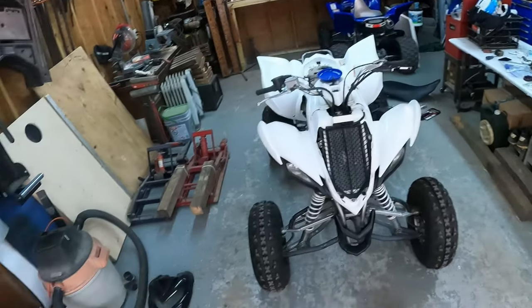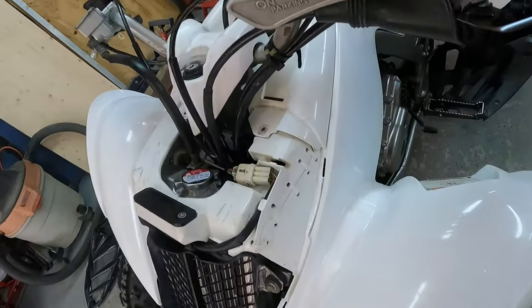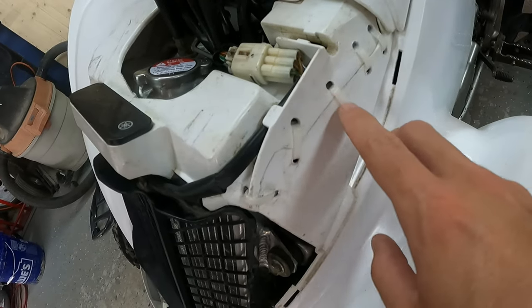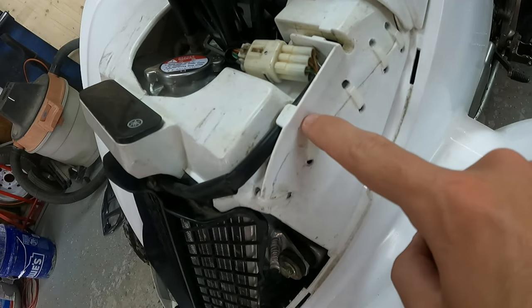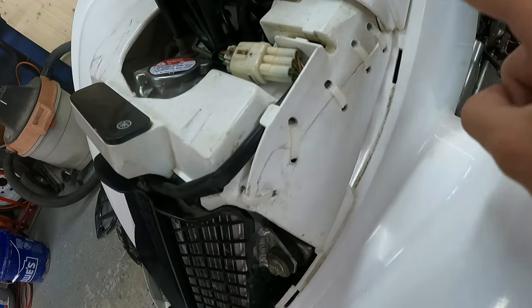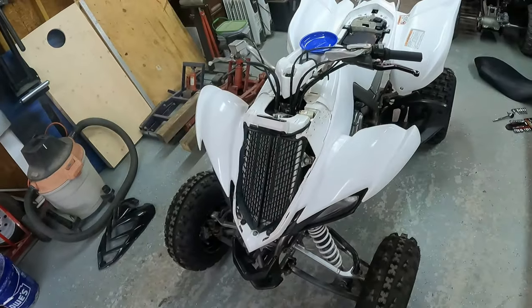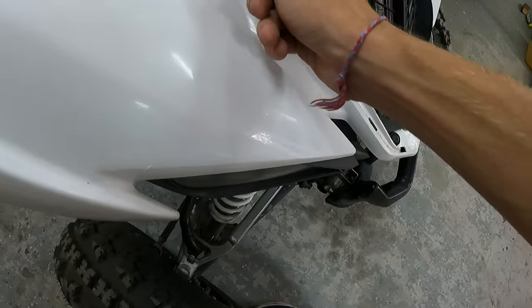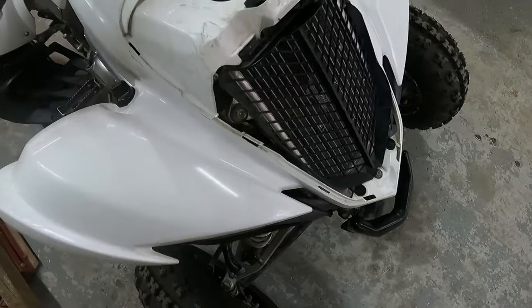Welcome back for a short break. If your bike has ever been rolled and the plastic is broken, here's a quick repair you can do. You can do a crisscross X pattern with zip ties, or what I did - drill two holes on each side of the crack, get a zip tie, thread it through, split it in between, and squeeze as tight as possible. You can also super glue it, but I'll probably just get new plastic in the future.